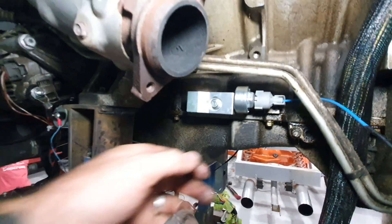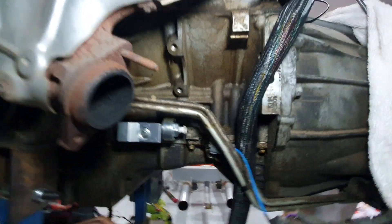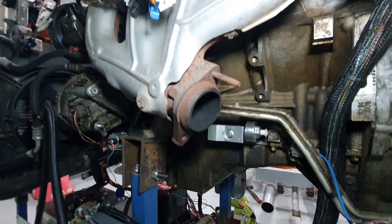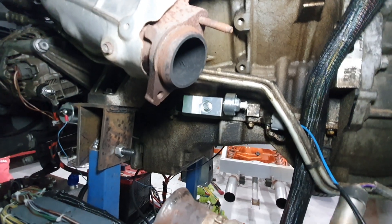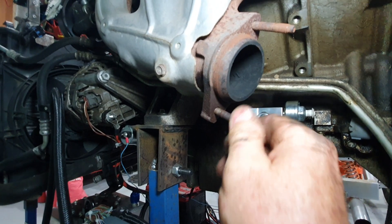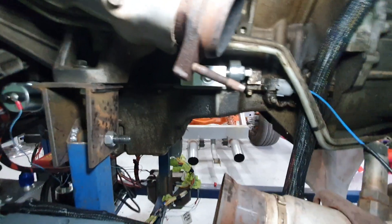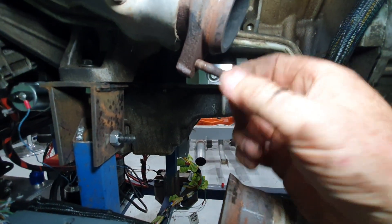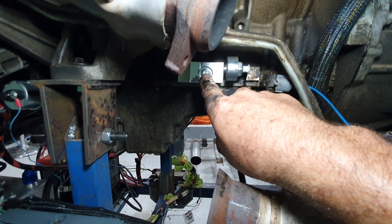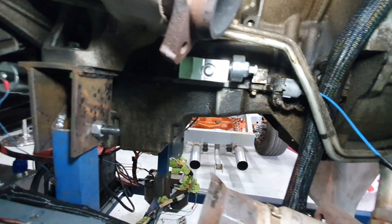I'll take that back out and take that off. Some of the issues I had with drilling here — you can see I had to take the exhaust manifold bolt and stud out. It's normally screwed in there like that, but if you look it was right in line with where I was going to drill the hole. Right there — that's where I had to drill the hole in the block for the taper bolt. Remove the stud, and the little block looked like that. There's one right there and another one back up behind there — you can choose whichever one you want.